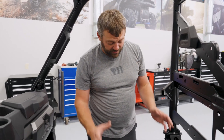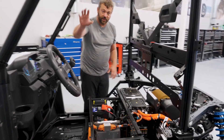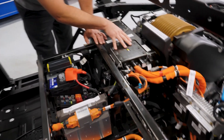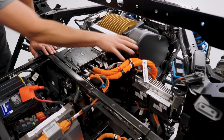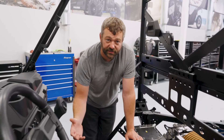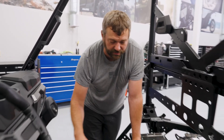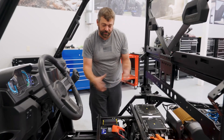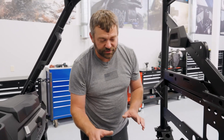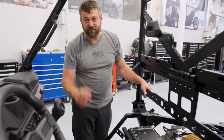There's a lot going on with all the different controllers and bits underneath the seat, but just remember: power starts from the wall, flows down the cable, comes to the charger, then goes to the 100-volt pack. From there it either goes to the motor controller and motor, or through the DC-to-DC converters for the 12-volt circuit — powering headlights, taillights, gauges, and power steering. Overall, this Ranger XP Kinetic is full of great tech, highly durable, with all connections nicely sealed and ready for the off-road environment.